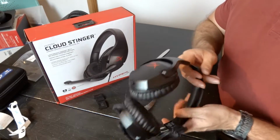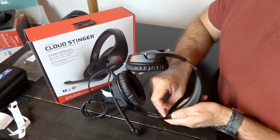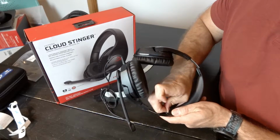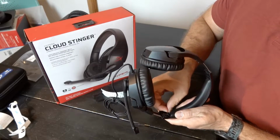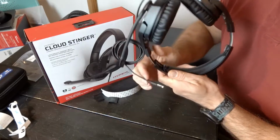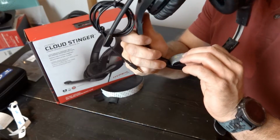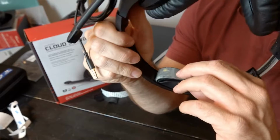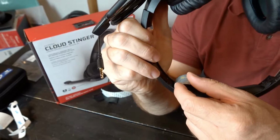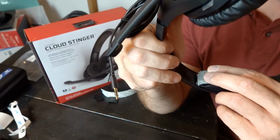Now all we're going to do to remove it is just use our fingernails, get underneath that plastic or headband edge and just peel it back. Be careful when you get to the middle though. So now I've pulled this all the way back. Now I'm getting to about 25% of the headband's come off, and now it's stuck to another piece of material that covers up the cable.